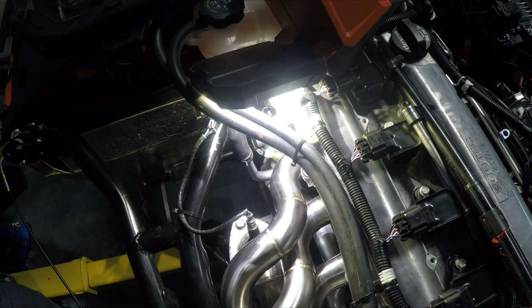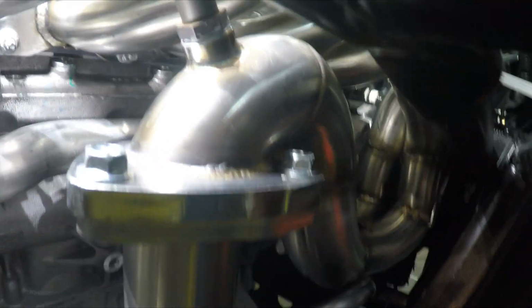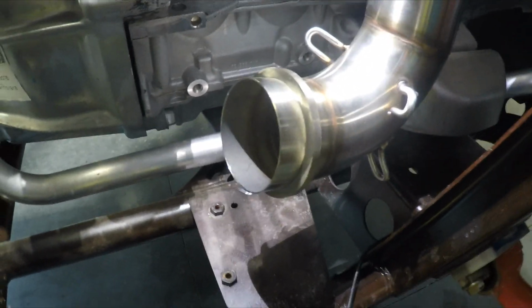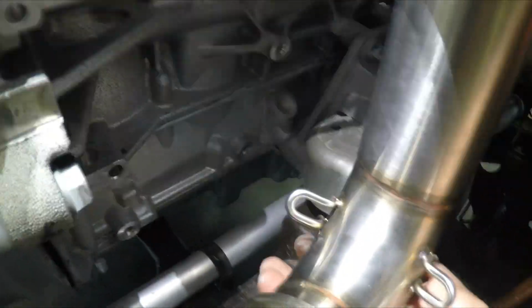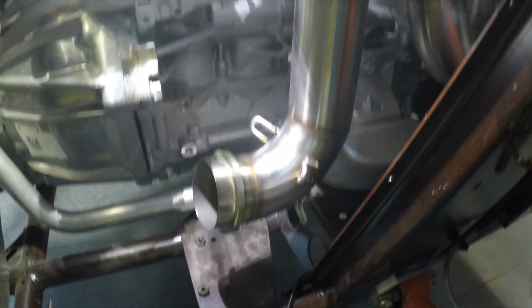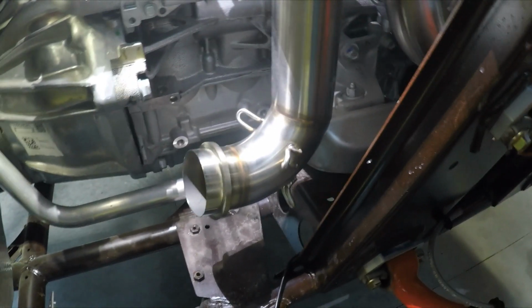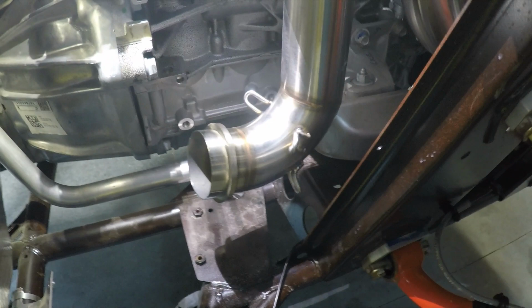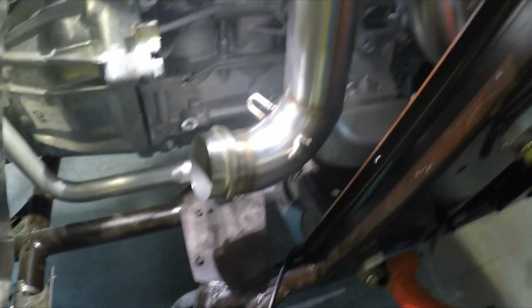Okay, after quite a bit of work there, that was fun. It's to get those 3 bolts in, and we got them in. They're pretty much 37 foot-pounds. So now we've got to hook up the muffler and hook the springs up. Looks like there's 4 ears on this, and we have the donut to put on. Now, according to Jeff Welter, we put high heat, high temperature gasket maker on that when we put that donut on. So that's the next step.